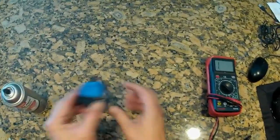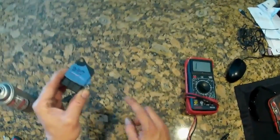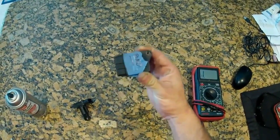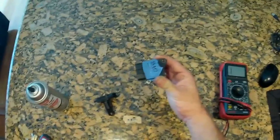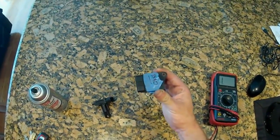The bad news is that it damages the airflow sensor. You can still put this in your car — no codes — and you think you are getting a great reading and things are good. Not so. You're going to have erratic readings that will affect your fueling.